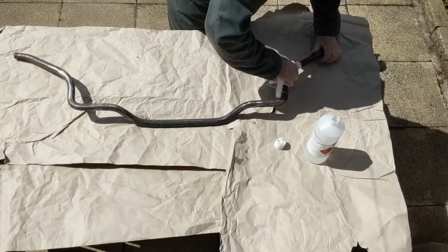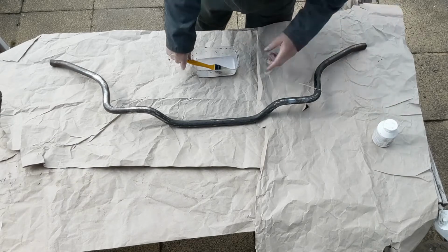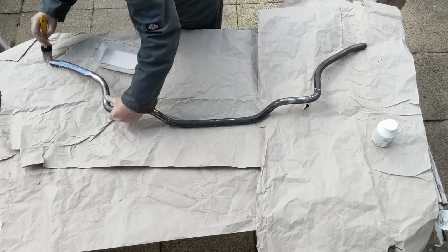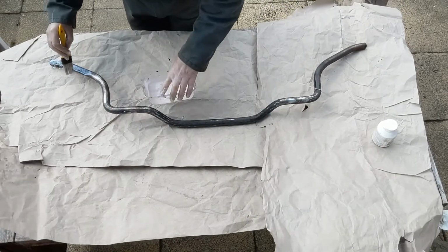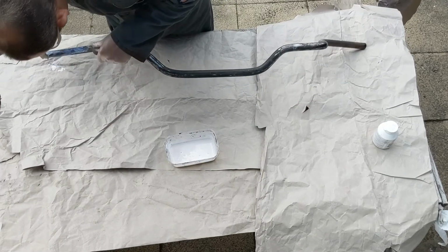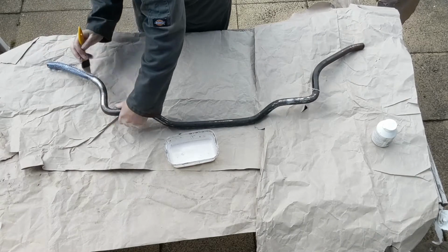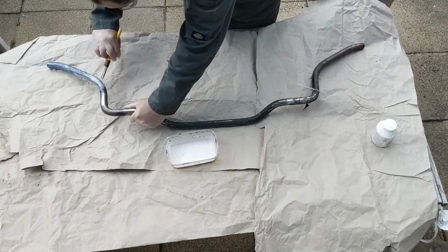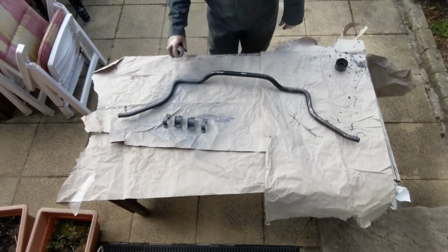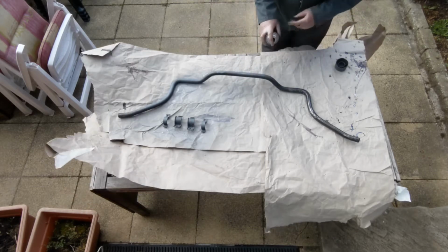And the next part of the process then, we will treat with the rust converter. We try and remove as much rust as we can first, just to make sure it doesn't start to eat its way back through again. We apply that to the full length of the bar, and then once that's had time to work and everything's clean and dry, we go over with a primer paint,